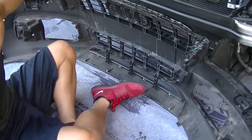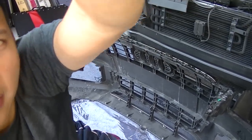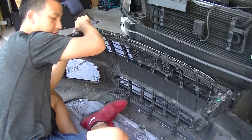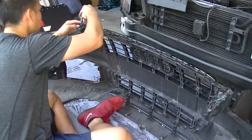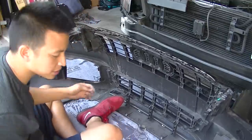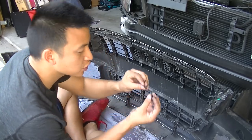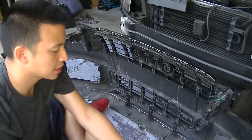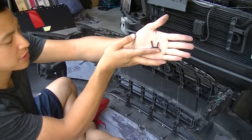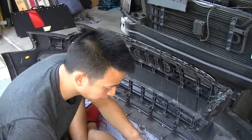Sorry, you can't really see this one — I'll get this a little bit higher for you. Now, don't screw these down too tight, because then you can break the tabs. Just so it's nice and snug. There are shorter screws and longer screws right here — you've got the shorter ones and the longer ones. The longer ones go around the outside, and the smaller ones here go into these three posts. So I'll do the three posts first.